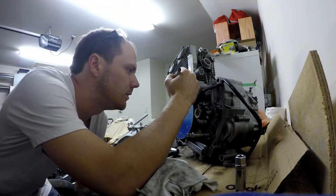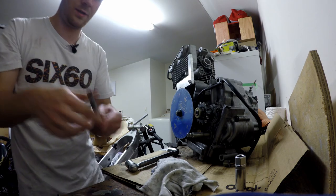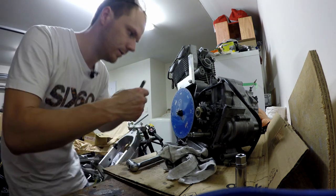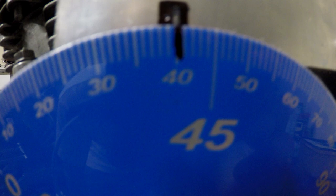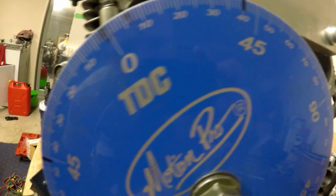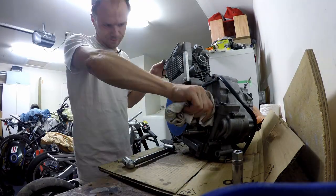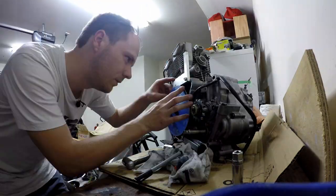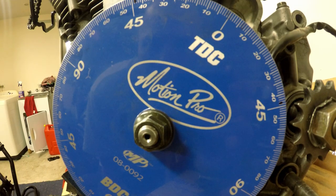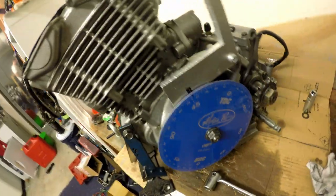Using a marker, we mark forty-six and a half degrees before top dead center. We then rotate it back the other way and mark contact again. Our line is on forty on one side and forty-six on the other side of top dead center, so we need to move it three degrees to the right. After adjusting, top dead center is set at pretty much forty-three and a half degrees either side, with zero being where the piston is at the top.